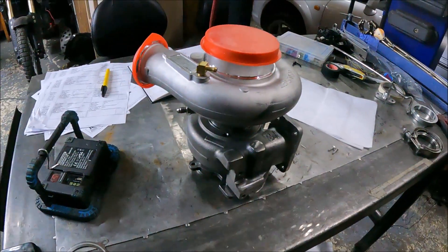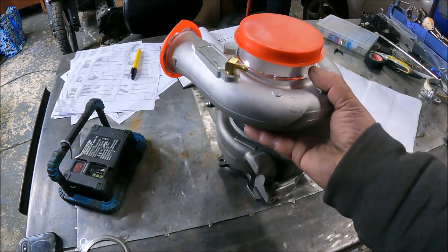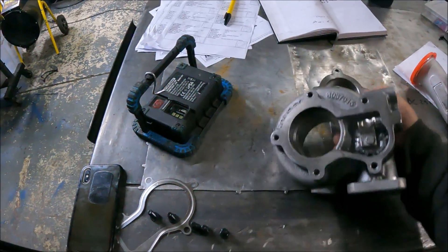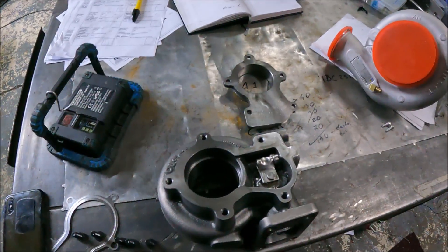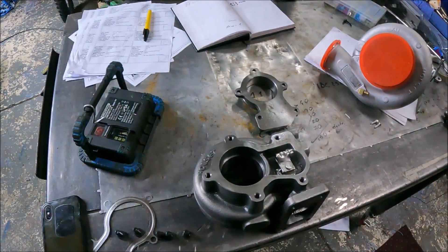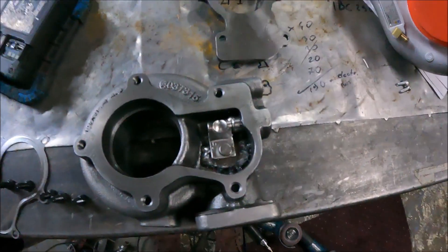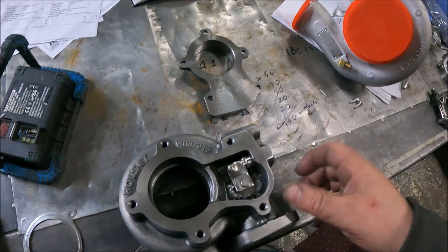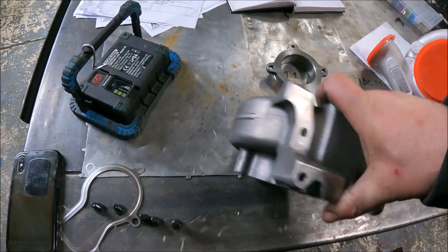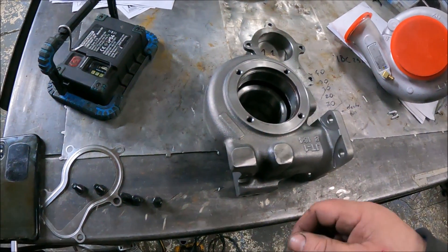Compressor Racer, who this is from, would do that free of charge anyway — but I'll show you just in case you've got it from somebody else. All you'd realistically have to do is weld the arm shut — a spot weld would do, because from the factory it's only the actuator spring holding it shut. I've gone much further: I've welded most of the way along there, removed and welded up where the arm used to be, and even cut off the two lugs where the actuator used to sit — for aesthetic reasons really.